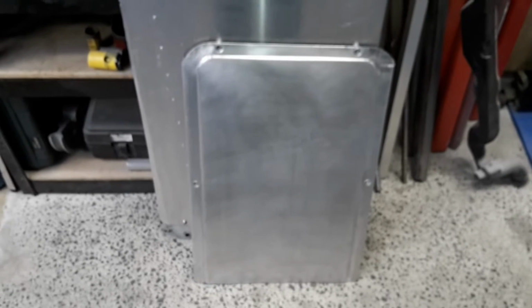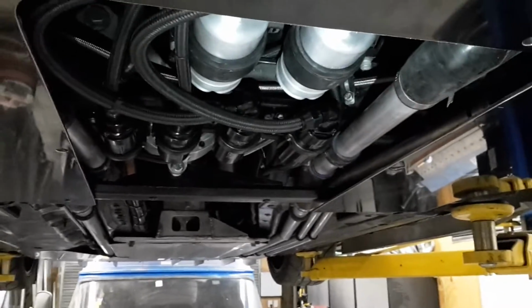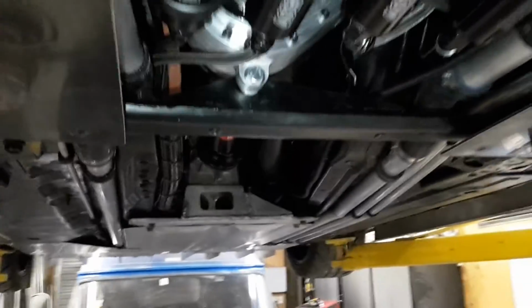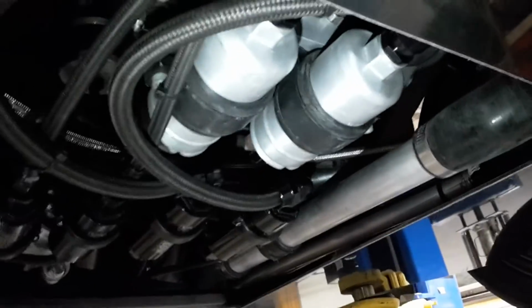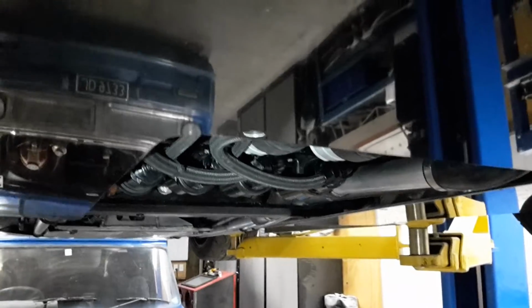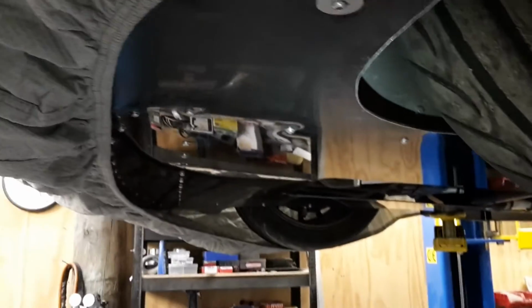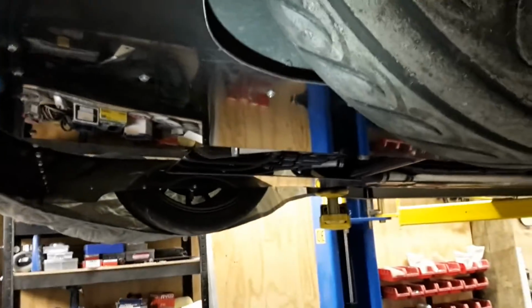So anyway, we've got an aluminium panel underneath that, and it's shaped very carefully, a bit like an oven tray, but it's open at one end. That end that's open is at the back, on the downhill side. So if we do have a leak here, that will travel out of the car as quickly as practical, while still having protection from debris, etc. hitting that. It's not as low as it looks. It is actually tucked away quite nicely. By the time you put the panel on there, there's a good amount of clearance between everything and the bottom of the car. And also, as you can see, it's actually quite a wee way back from the front of the car. So, should be pretty good now.